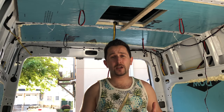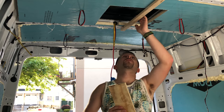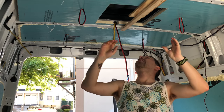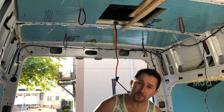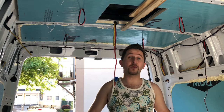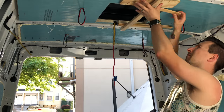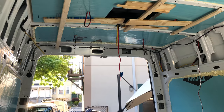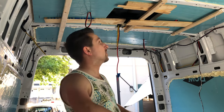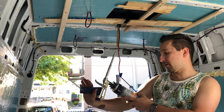We have the AC in place now. In order to get the air distribution box in place, we would need to have a finished ceiling, which we obviously don't have yet. So what we're going to do is put some padding up to get the insulation in place for now, then use Titan Extreme Temperature expandable spray foam to foam it in and hold everything up.